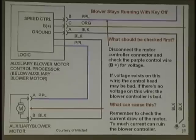When you went on a bumpy road, it put the loads on the back. It pulled on G405, the ground on this GM car, which is shared by 14 loads of light bulbs plus the fuel pump. Those old GMs in the 90s had big light bulbs, six of them, three on each side, plus the third brake light, and at nighttime it was worse with every other load on the car. So think about this, keep this stuff up here.